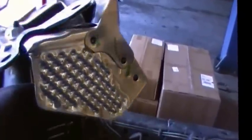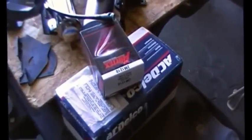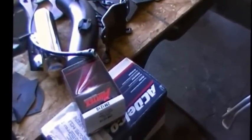Here are our motor mounts — these are the factory OE hydraulic motor mounts with shields. They run about $100 each, but it's a pretty serious mount. It's liquid-filled and it dampens out most vibrations much better than polyurethane or rubber biscuits. This mount is necessary for AFM motors — MDS, DOD, cylinder deactivation — because when it goes into four-cylinder mode, it sets up vibrations. With a crate motor, you're going to need a new starter motor. We use Delco — don't get a Chinese copy. They run about $160, but it's better than not being able to start your JK out in the middle of nowhere.